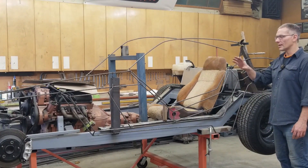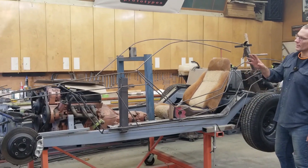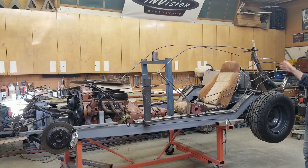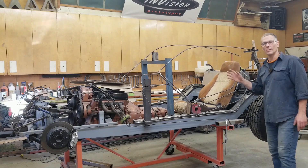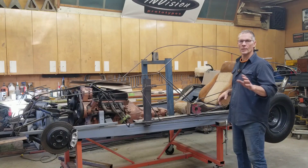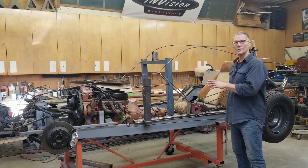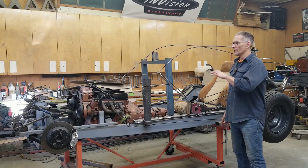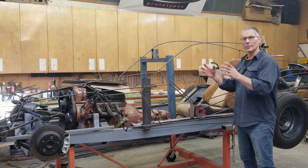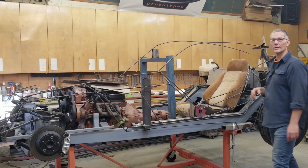Over the past few weeks we've been mocking up the chassis and developing the wireframe buck, the structure right here. Now you might be looking at this — you've got the engine, got the suspension — but we've got no rad up front. Well, it's back here, and the reason I put it back there is I wanted to bring that front down nice and low, make this into a really sleek little roadster. We're utilizing the InVision Prototype signature chassis, a hot rod chassis for this project. It's going to have four wheels and coilover front suspension. Those coilovers being put inboard inside the chassis take up some space, so that's another reason why I moved the rad back there.